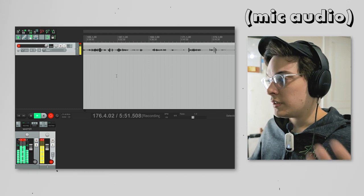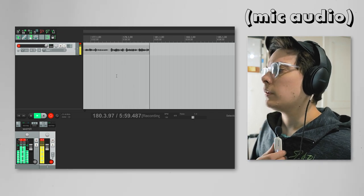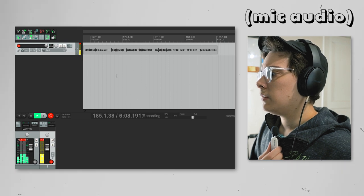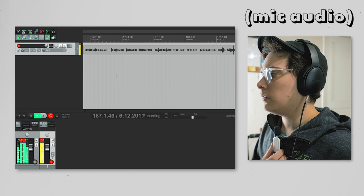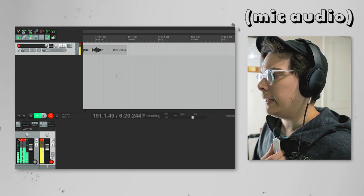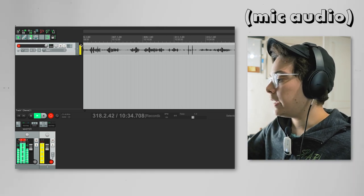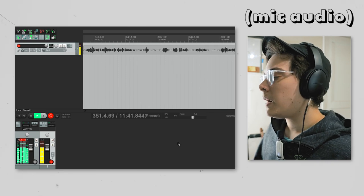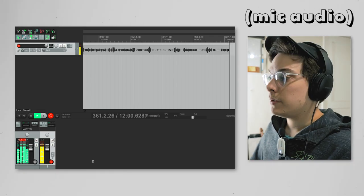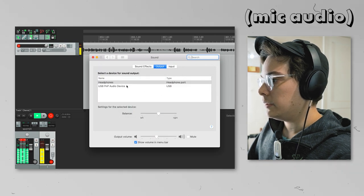Let's switch over to the mic audio now. This is how the Alvoxcon USB microphone sounds. All things considered I think it sounds pretty good. The signal is fairly low — we might want to bump it up a little bit. Instead of increasing gain in software we can just control it via the two little volume switches on the sides of the transmitter. At its absolute lowest — check check check, one two — and then we'll bump it up. As far as using this mic with your computer, that's kind of all there is to it. You clip on the transmitter, turn it on, plug in the receiver, and you'll see the green lights turn on. The mic pops up in your computer's audio input settings. If you want the mic to be your computer's default input, go to System Preferences, go to Sound, and select USB PNP audio device.